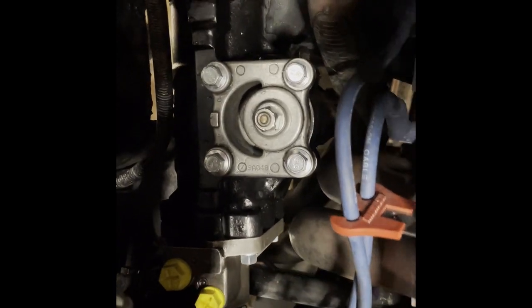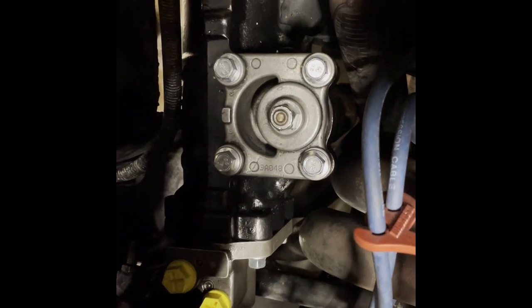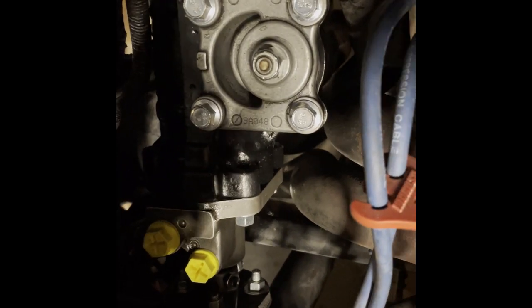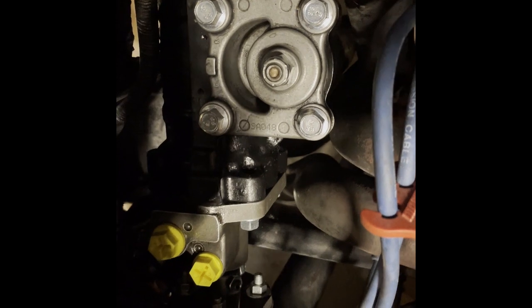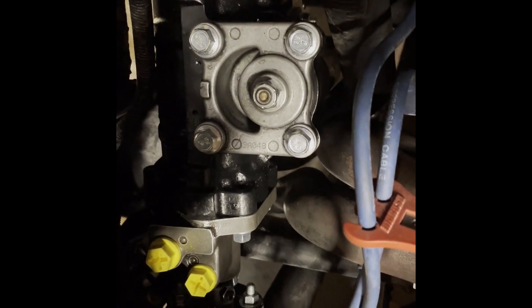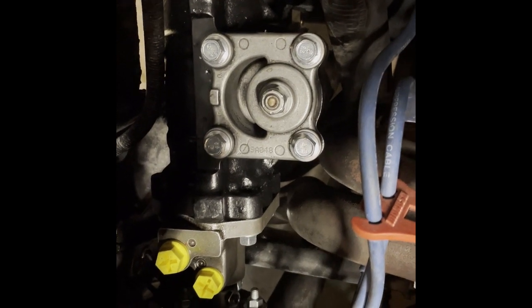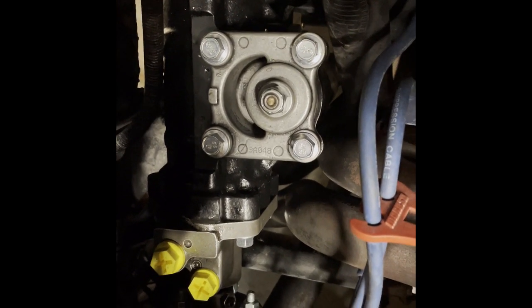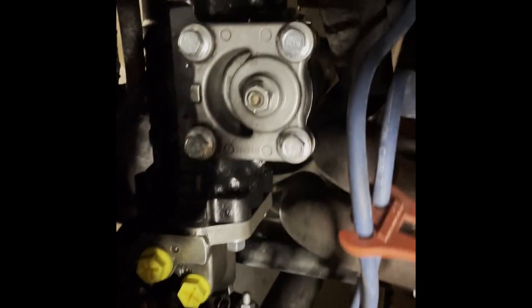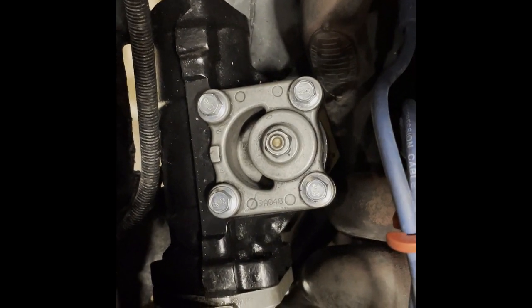All right, I'm happy to report that you can, without removing the headers, get the Borgeson unit in and attached to the steering column. The column did have to go in towards the passenger compartment about 2 inches. When you're pushing that column in, you have to tap it with a hammer. I used a rubber mallet. Go slow and continue to do fitment. You don't want to have to try to pull it out. I hit mine exactly in, but the header stayed on and I was able to get the unit in.